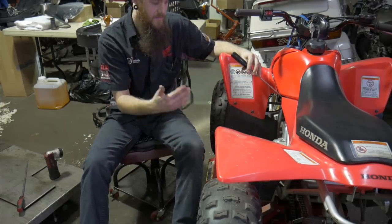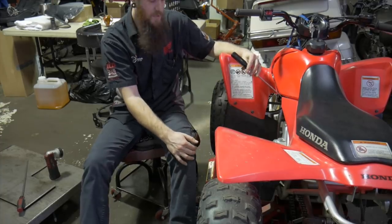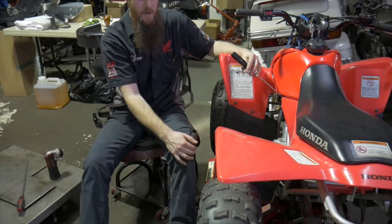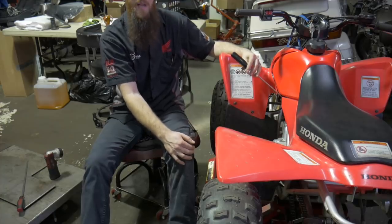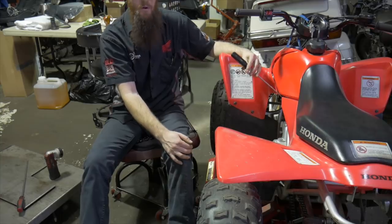All you're really doing is feeding it more fuel into that air-fuel mix for the idle circuit. Don't get too hung up on, well, mine's not 3.5 out, it's best at 2.5. Well, great, you found what it's best at, stay there. I'm just saying don't go over 3.5.